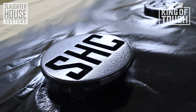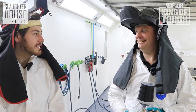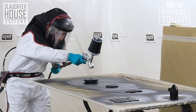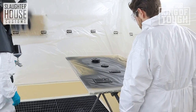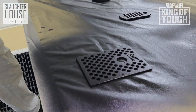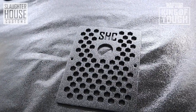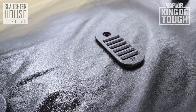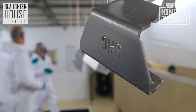We're going to let that set for 30 minutes — grab a coffee while we wait. Now 30 minutes later, the glory coat. You can see how that change in application — the distance away from it, the pressure was dropped — has really changed that appearance and gives you almost like a factory plastic texture. Still wet, so we've got quite a shine on there, purely because the solvent hasn't yet come away from the product. As this dries overnight it will go more of a matte semi-gloss. Let's let these dry off and get on with the metal bits.